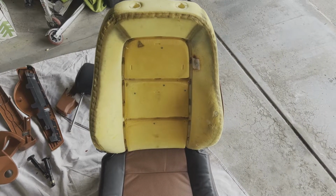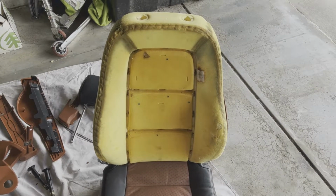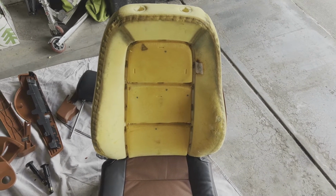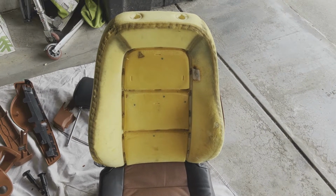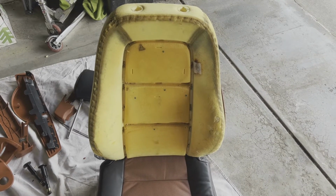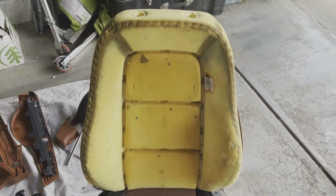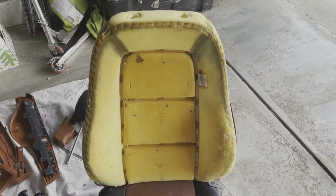All right, so now it's time to put the skin on the upper, which again is the same basic procedure as we used on the lower, where you hog ring it in to the metal and fabric, the metal supports that are in the fabric guides, and into the metal supports that have been built into the foam of the seat back itself. So I'm going to do that now, and good luck with yours.